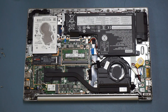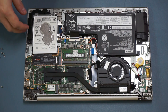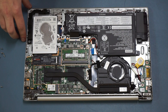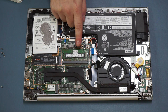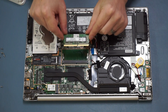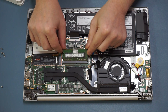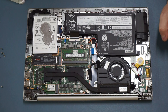If you only wanted an M.2 SSD, you could remove the traditional hard disk, or you could replace it with an SSD for additional capacity and performance. Now, regarding memory: most configurations of this laptop come with 8GB — 4GB soldered onto the motherboard and a traditional SODIMM slot. If you've worked with SODIMM slots before, it's easy: just pull the two metal tabs, the chip raises, and you pull it straight back to release it. This example has 4GB onboard and a 4GB stick. You could potentially upgrade that stick to 8GB, giving you a total of 12GB. Unfortunately there's nothing we can do about the soldered 4GB, so there's no way to get this system up to a 16GB configuration.